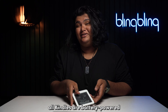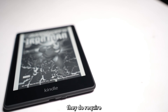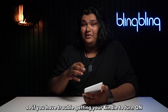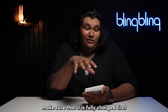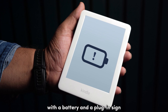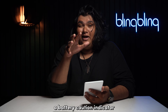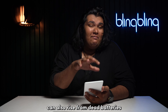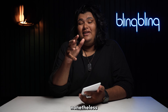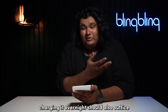All Kindles are battery powered and even if they stay powered on for weeks, they do require occasional charging to sustain the battery. So if you have trouble getting your Kindle to turn on, make sure that it's fully charged first. On newer Kindle models, a battery low indicator with a battery and a plug-in sign appears on the screen once it's low on power. A battery caution indicator can also arise from dead batteries and it can also indicate various other issues. Nonetheless, plug in your Kindle to charge for a whole day before turning it on. Charging it overnight should also suffice.